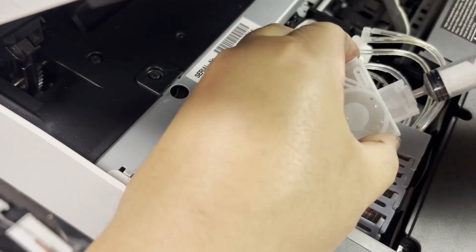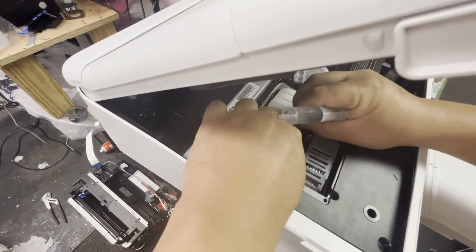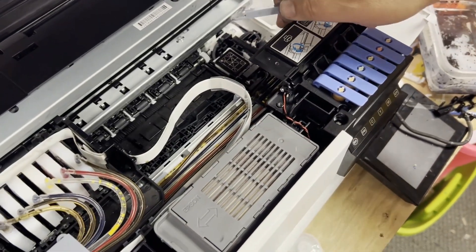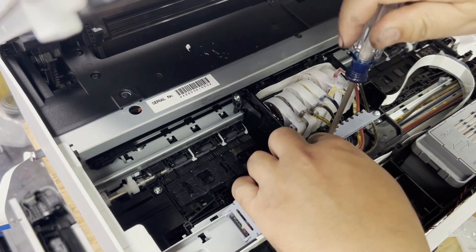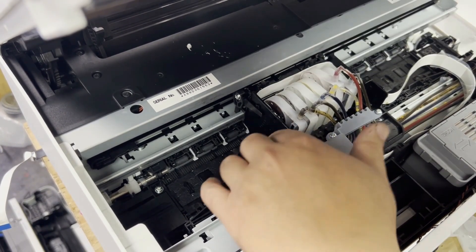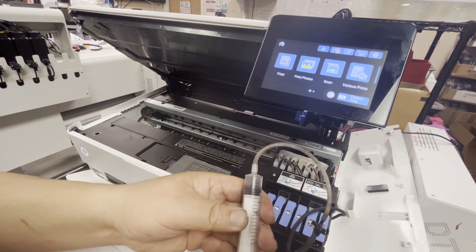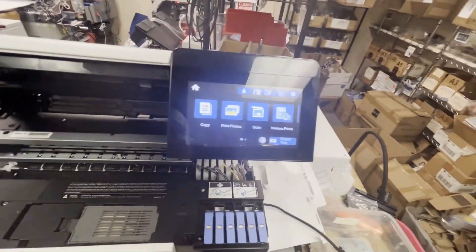Now I need to fill all the dampers with ink. I just get a regular syringe and draw it — the ink is going to flow into the dampers. Notice I don't have the catch lock assembly installed. To prevent the tubes from hitting the printer — the tubes usually wrap and hit this part of the printer — I installed a simple tube holder. It has two screws that go right into the two holes left by the bottom of the lock assembly. I push the tube down so the tube goes to this side and will not hit the printer. Then I park the printer on the capping station and slowly draw a little bit of ink. You should feel slight resistance, and that will prime the new printer. Now we can just go back and draw.